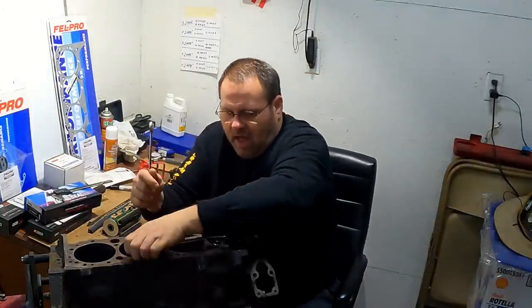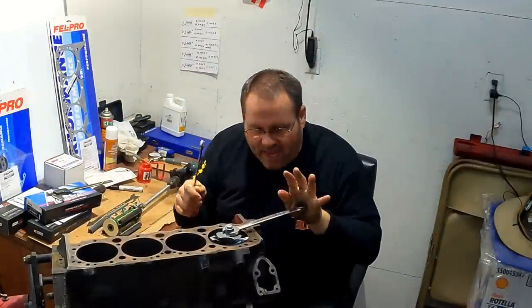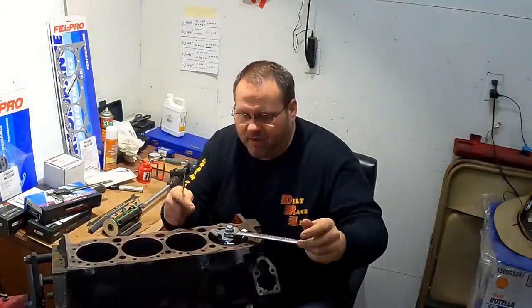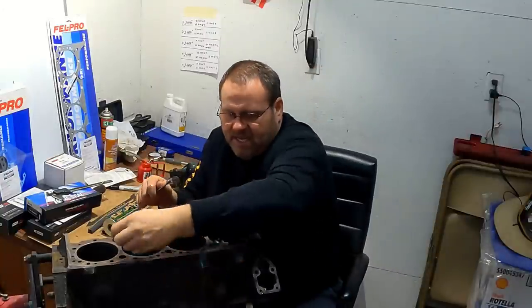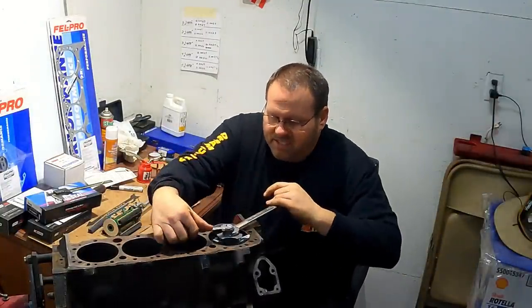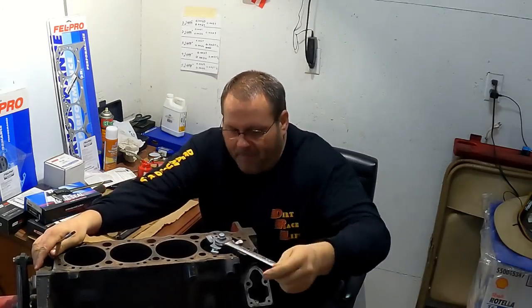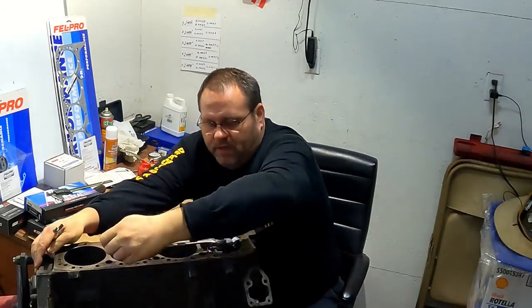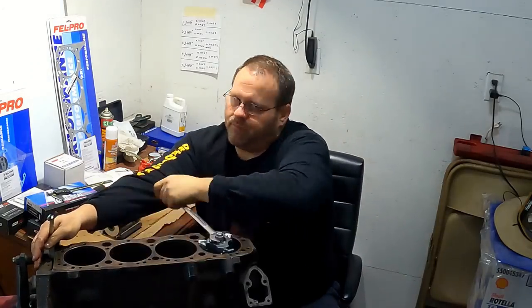Only turn it clockwise. Don't back up. Don't get it real tight and bark into it and stop, because you'll create a ridge point. I just want a nice even cut, so I just keep going around and take little tightening-ups. Now, that cylinder may not be perfectly round, and for that reason, it might go tight, loose, tight, loose, tight, loose. Don't freak out about that.